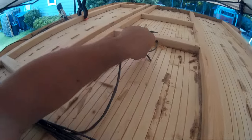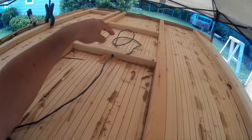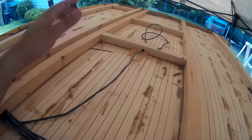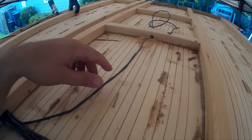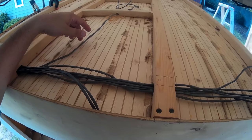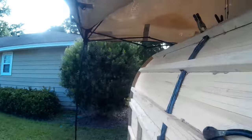One important thing if you use a Fantastic Vent: this is the roadside — the driver's side of the trailer. On that vent it makes it a whole lot easier if you have the wire wired into the left side. The vent is going to be in that square area right there, and we've got the wire coming on the left side. If you ran it in the middle, the other side, or a different location, it's going to be a lot more difficult to wire in. Other than that it's pretty simple — it looks like a lot of wires but it's actually not bad. Pull one wire to a location for a light; if you want a switch, pull a wire into the switch and out of the switch into the light.